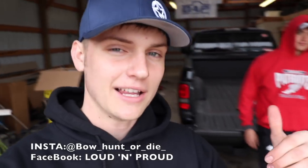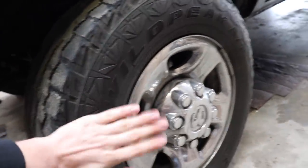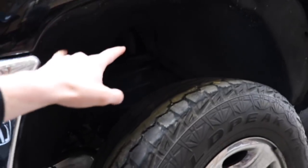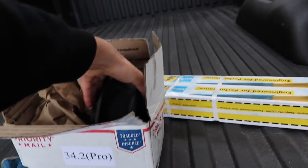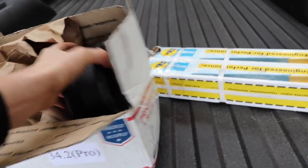What is up loud and proud crowd, I hope you guys are doing absolutely fantastic today. I got my buddy Jesua here up from college on a little weekend break to hang out. We're going to be trying to do the leveling kit on the big stinky today — jack it up by the frame, put jack stands under it, drop the front linkage, take off the wheels and tires, get out the three nuts up top, remove the coil and strut tower along with the shock, and swap it all out with our spacer kit from Supreme Suspension. Not a sponsored product, but this is what we run on these trucks — link always in the description below.